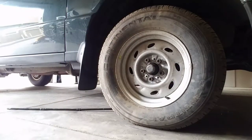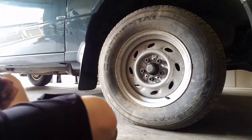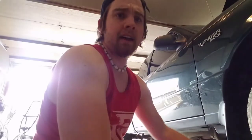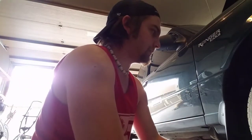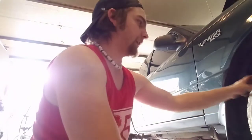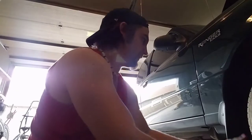That's how you change a tire. If this were a real flat, I'd take the jack and put it back. You don't have to put the flat tire back where the spare was — you can just throw it in the bed of your truck or your trunk. You'll just take that tire somewhere to get it fixed. This is just to get you from A to B. Then put the jack and the extension poles back to where they were, like I showed at the beginning of the video.